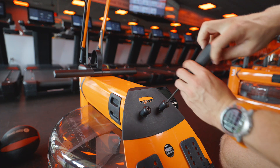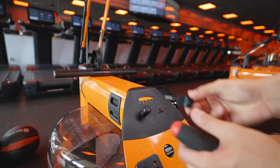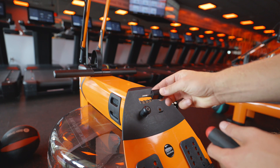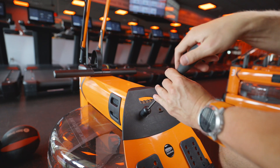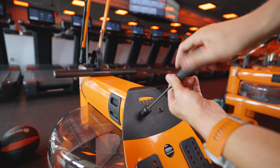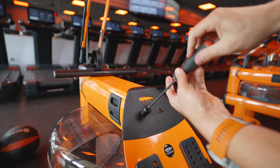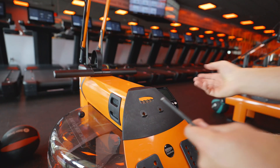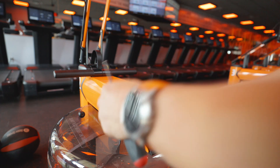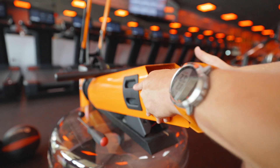Note when putting the bolts back on, there is a ledge — that flat part is supposed to sit on that ledge, which is where the rower handle is easily racked. I always put them on their respective sides — left bolt goes left, right bolt goes right. You're going to lift up the foot plate, which will reveal and allow you to pull the hood completely off. Simply lift a little bit, slide it back towards the rower foot plate, and set it off to the side.